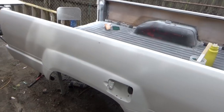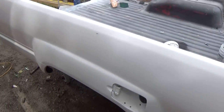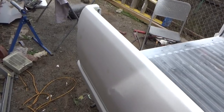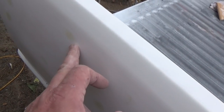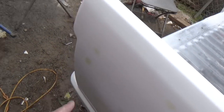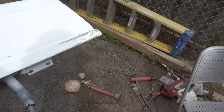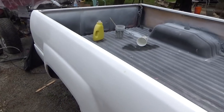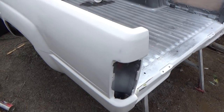All the little minor imperfections I got sanded out — or most of them, hopefully most of them anyway. You can see that left just a little bondo where the little holes were. Looks great. The tailgate I sanded back out again, ready for some primer, and this side's ready for primer too. So I'm going to mix up some more polyester primer and throw it on this thing. I get a lot of questions over what kind of primer I'm using.